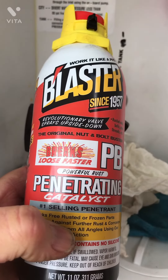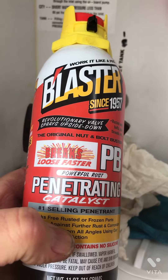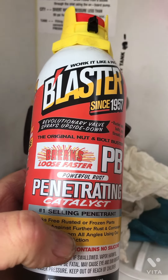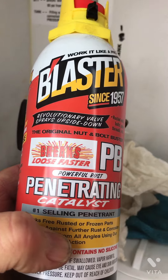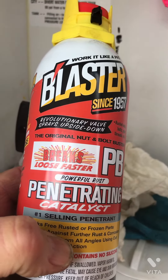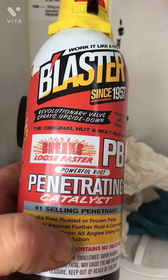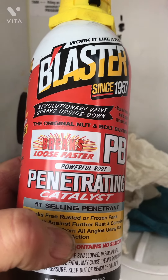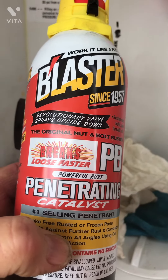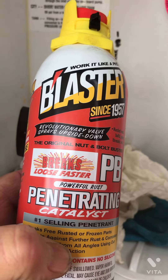And this is the stuff that I use. I do not use WD-40 — I threw all that out a few years ago. The PB Blaster Penetrating Catalyst is real good stuff. It will break free and clean any rust on moving surfaces as well as nuts and bolts. And the other nice thing it does is it's got lubricating ingredients built into it. So not only does it help remove the rust and stuff, but the lubricating items that it has prevents further build up.